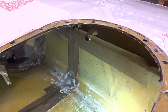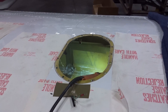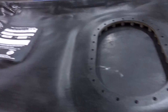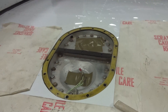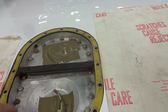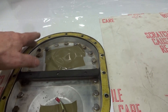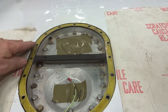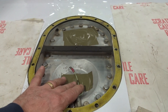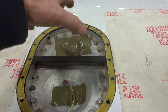That line up there is for the fuel tank vent. What goes on top of this is an adapter plate that will bolt down to the top of the fuel cell with a gasket. This is the main tank, which we've already finished. The adapter plate will go up to here and it's held in with just a couple of little screws. Once the outside inspection plate goes on, that'll complete the process. There's a fuel quantity sender that goes here, and the fuel cap goes here, with a little door to open to access it.